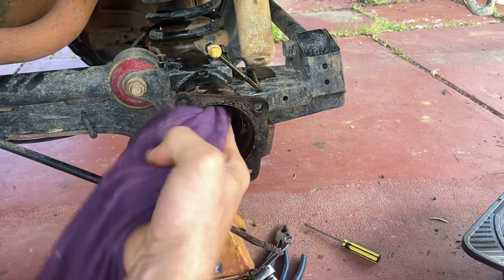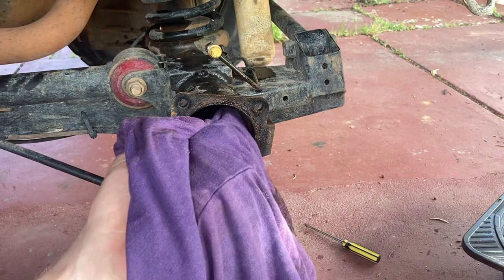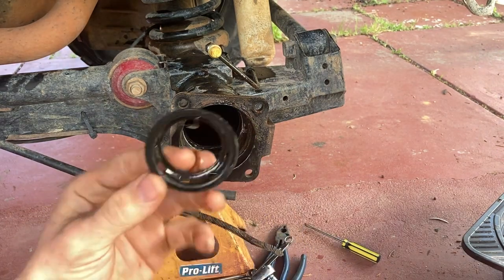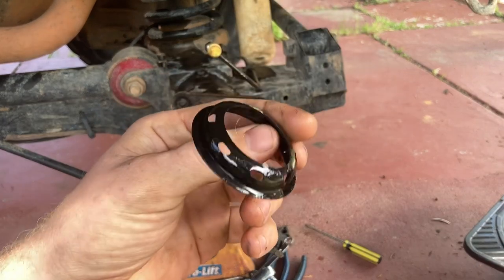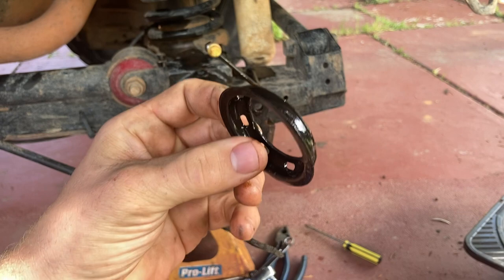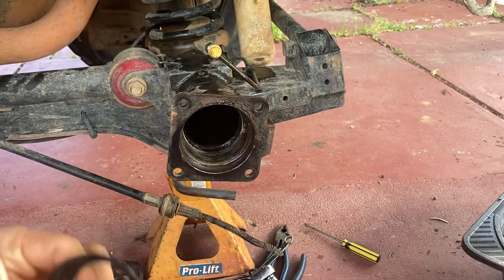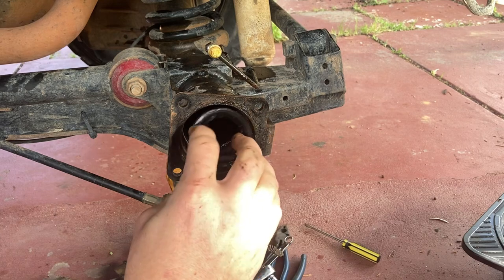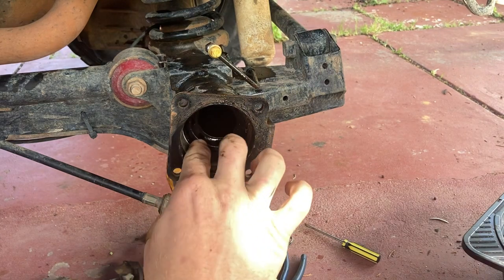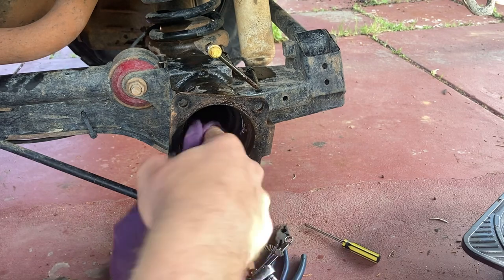Let's give it a good clean up in there. That's your bearing cage — just to protect the diff centre in case your wheel bearing ever explodes. So that just goes in before the seal. You don't even have to take it out.